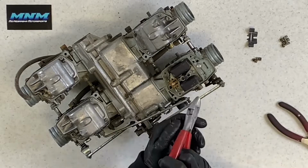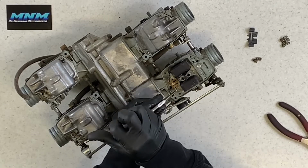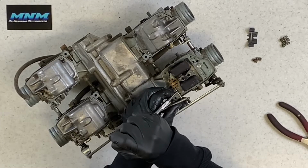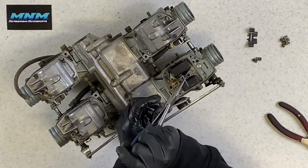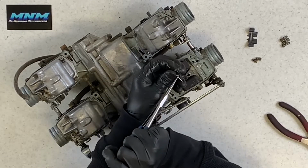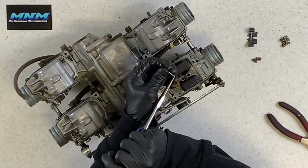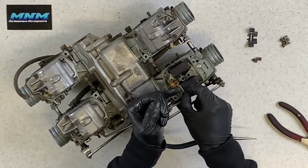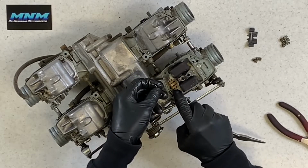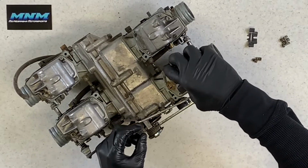Now I grab a pair of pliers or side dikes, depending on how hard it's going to come out of there. I like to grab little needle nose pliers, just because at that point you know that you're not going to put too much pressure on there, you're not going to break anything. Take and pull that out. Keep in mind which direction that goes in and out. Sometimes these are tapered. And this just so happens that where I pulled this out with the side dikes beforehand, it is a little bit dinged up. So I'm not going to try to push that dinged up end all the way through. I'm going to start with the clean end, slide it in there. Our dinged up end will be right at the edge of that post there. So set that pin aside. Now we're able to take this float out.